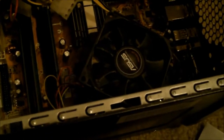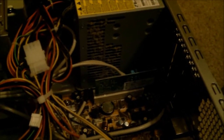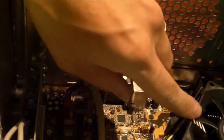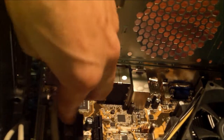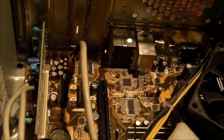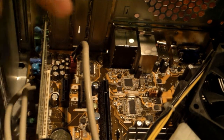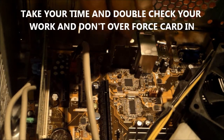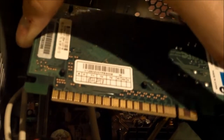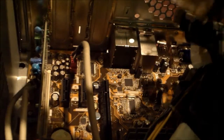If you see any dust inside, I would vacuum it out — there's a lot of dust in here. Dust will actually overheat your computer. Now that we have the computer opened, you'll see the processor and fan to the right — clean that out with the vacuum since you have it open. Here are your video slots. Make sure you touch something metal to discharge static electricity from your body. You can also wear a grounding strap around your wrist — it's about a dollar.